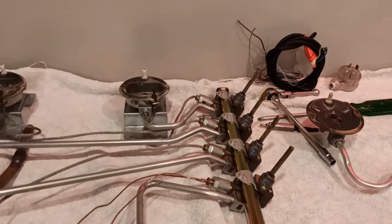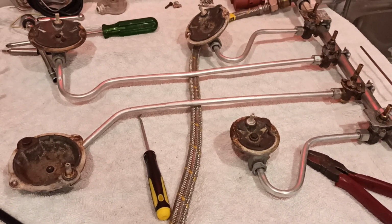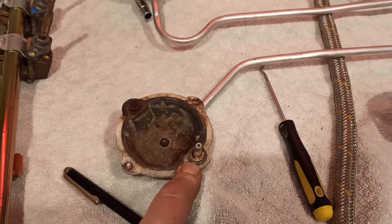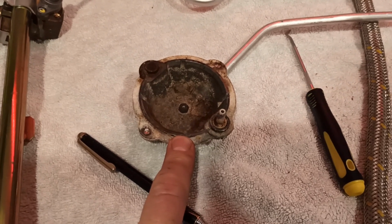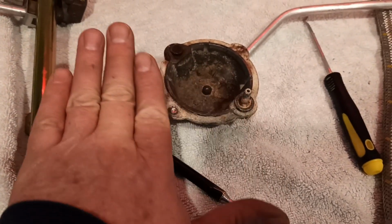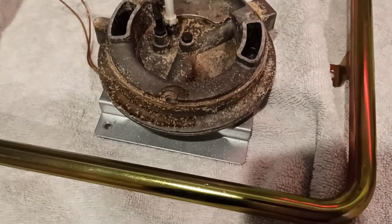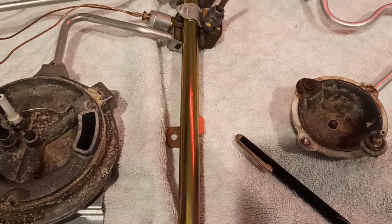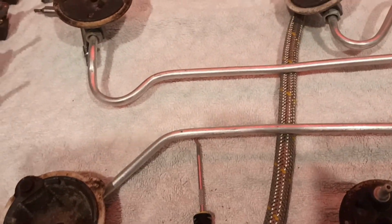So that's most of the wiring stripped down. Things of interest. Let's start with the cheapie first. As you can see, it looks very clean from what we've got, and that is because there is only one wire running to the gas burners. And well, that's another thing of interest, is that there is the wok burner on this one. It's quite small compared to, well, there's my hand just there. There's the wok burner on the other one. It's much bigger, therefore more gas, therefore more heat. But I bet up the top where we could all see, I bet they both look exactly the same, and you're wondering why the cheap one just wasn't doing your stir fry properly. So that's an interesting one.